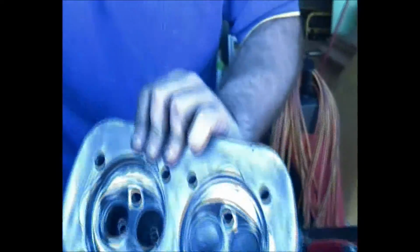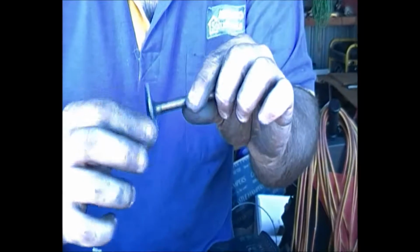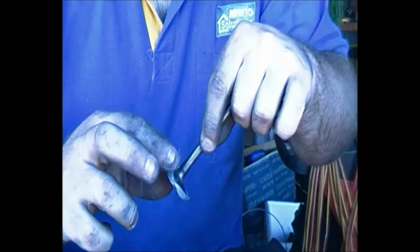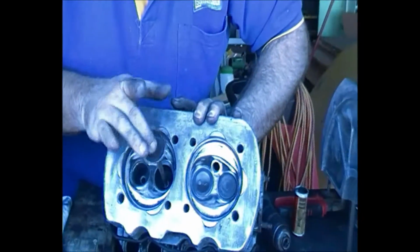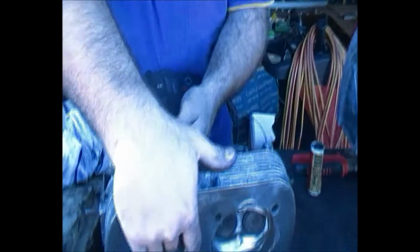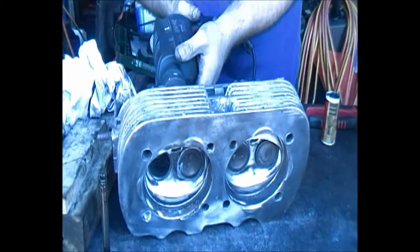Obviously, after every run, you've got to clean out the surface to make sure you don't leave any of the paste over from the last time. So, as I said on the tube, that end was the coarse, this end's the fine. It's a lot lighter in its colour and a lot smoother in its consistency. So, we just give it a run around. We go again.